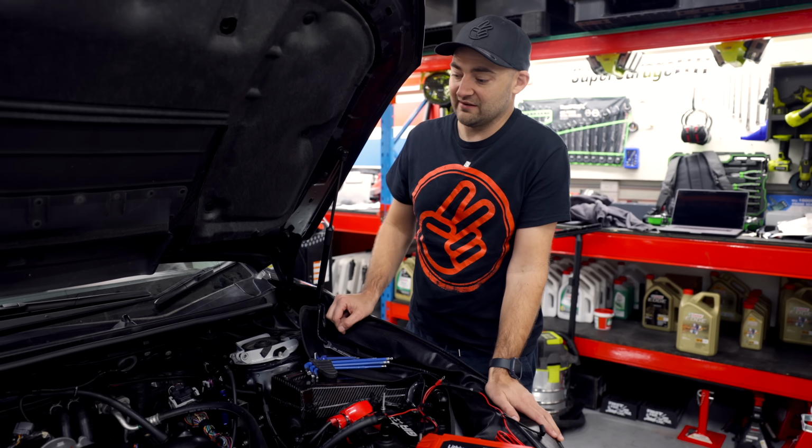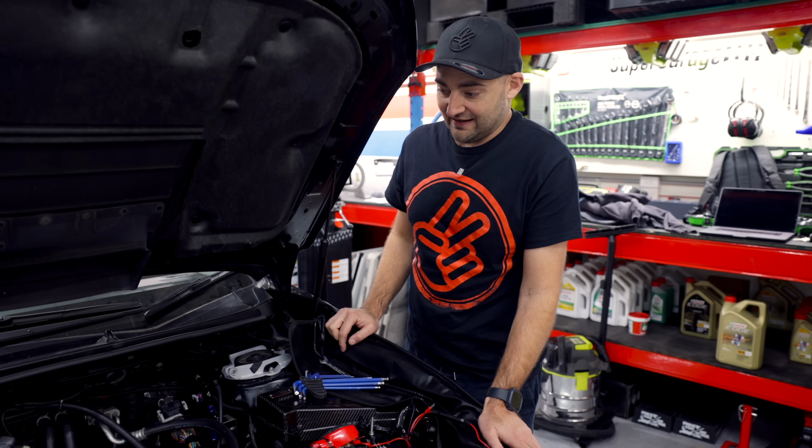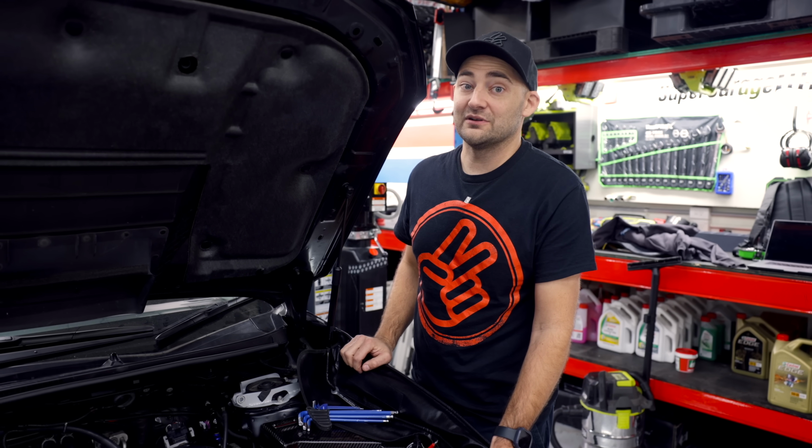So now we're at the point where we are going to be calibrating the throttle. We are going to be able to set our base fuel pressure and then crank it, make sure it's actually got oil pressure and everything's happy. Then we can add fuel into the mix and see if it will fire.